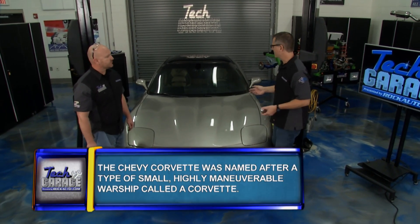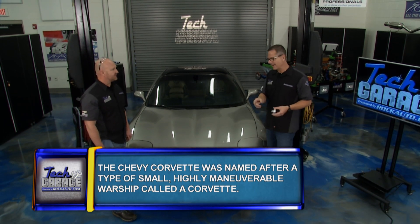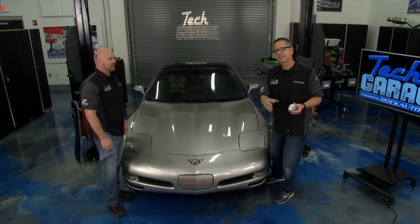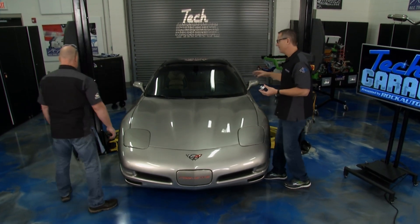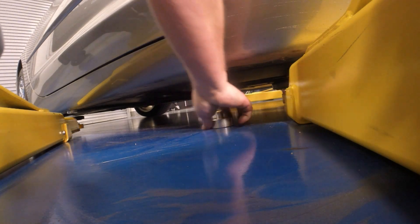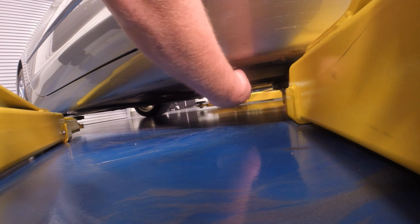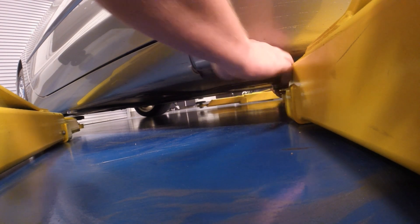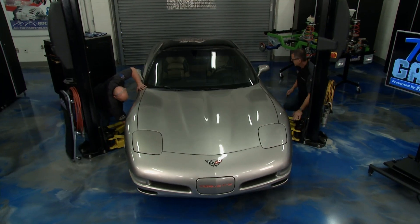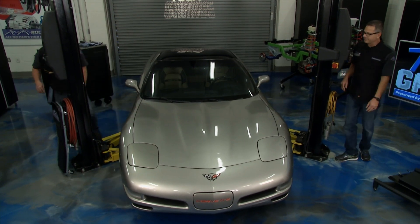Now lifting — there's an art form to that as well. We always have the car up in a poof, but not this time. We're going to show you how to do it right. The Corvette actually gives us some pucks — lifting points. These go right into the actual frame. You can feel the steel frame right under there. Once you've got the lift puck in, you're going to center your lift right underneath that.